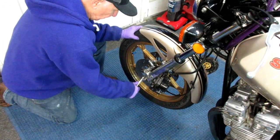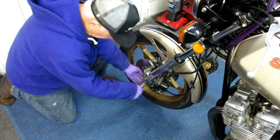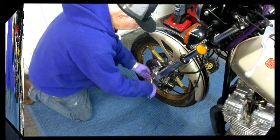And these are bolts that I would always make sure I have before I put them back. Take the nuts and clean them with brake part cleaner and re-Loctite them. This is always one of the concerns I have, is keeping this front end tight.